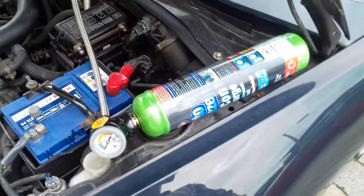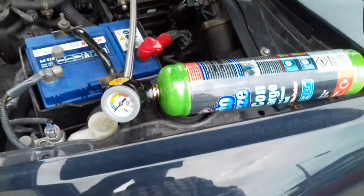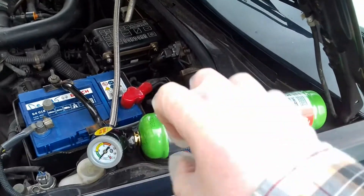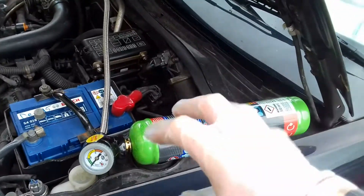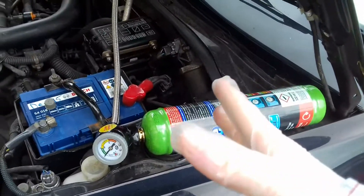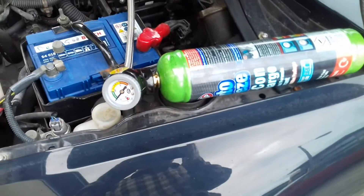That's it attached with the bottle attached. As you can see, it's still back down to the needs-to-be-filled mark. So you hold the bottle at the 12 o'clock position for a few seconds, give it a shake, rotate between 12 and 3, constantly rotating. Don't keep holding onto the trigger the whole time — you squeeze it, let go, squeeze it, let go, squeeze it, let go, until it hits the green mark.